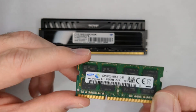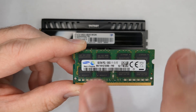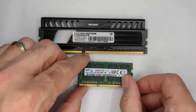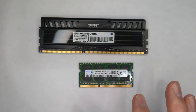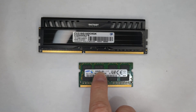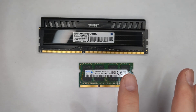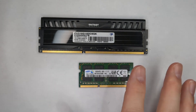When you purchase, I would go for memory in sets of two — get a pair. The reason for that is you get better performance with dual channel. So if you have the choice between getting one 8-gig stick or two 4-gig sticks, go for the two 4-gig sticks. The most you can put into a G1 is 16 gig.